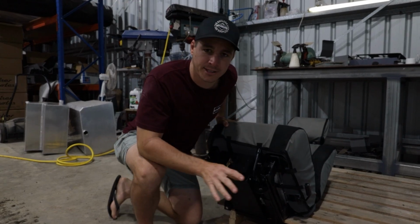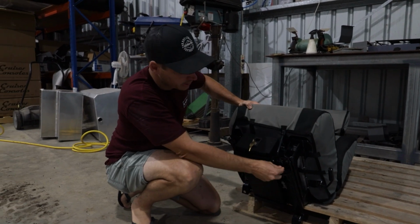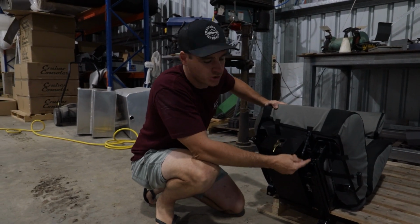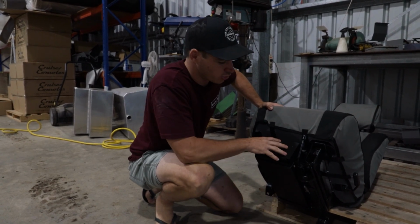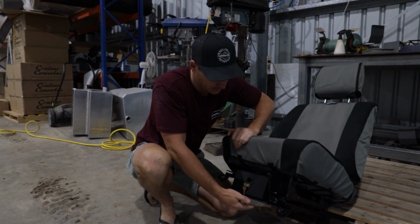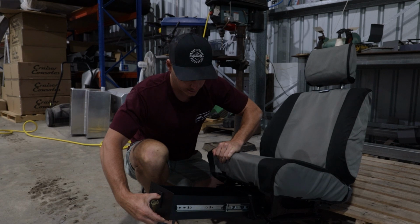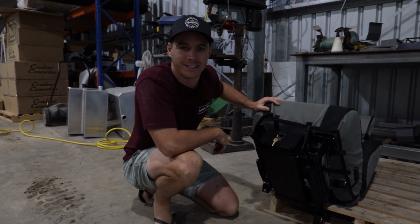Just pulled the seat out. This is how you install the under seat box. So basically you just pull out your factory seat slide, and you use all of the factory mounting brackets and factory bolts. The brackets for the drawer just go in between your actual seat mount and the slide. It's that simple, tucks in there nice and neat, and away you go. Key on the front, pretty bloody neat, eh?